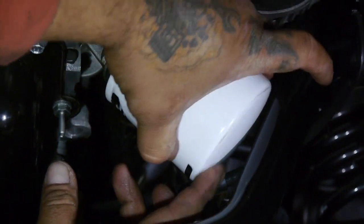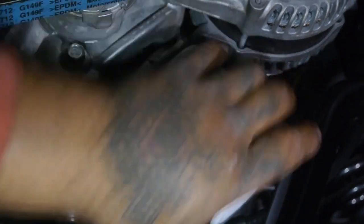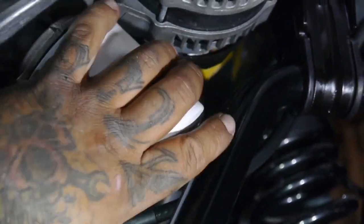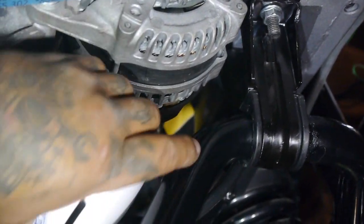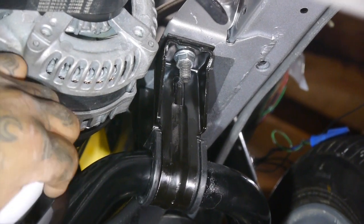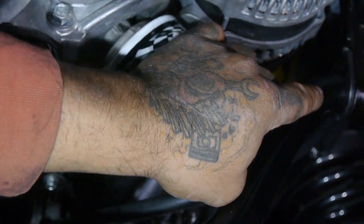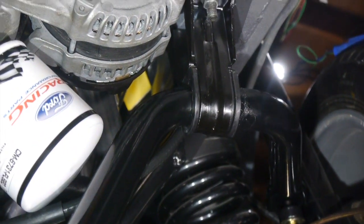We gotta make sure - we're not pulling punches here. It's gonna go in, but is it gonna come out? We're not being sponsored or anything. We have great clearance to the oil filter, great clearance to the alternator - and we have a sway bar in the front, hell yeah, without cutting! We didn't have to cut off our sway bar brackets up here. I definitely suggest for everybody out there doing it without a sway bar: go put a sway bar on it. Weld your brackets back on and put a sway bar - that's how you drive steady.